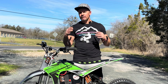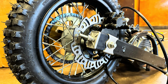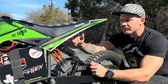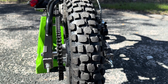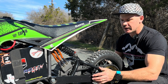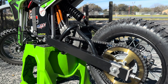Starting from the front — this whole kit comes in the box as a bolt-on solution. This is probably a prototype; the version you buy may look different as changes were made after community feedback. On my kit I'm running a 280mm Fast Ace shock, about $140 on Amazon. The kit includes the motor, the swing arm, the chain, and the sprockets. Gearing is an 11-tooth front and 52-tooth rear on a 420 chain.